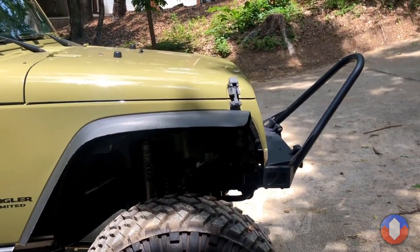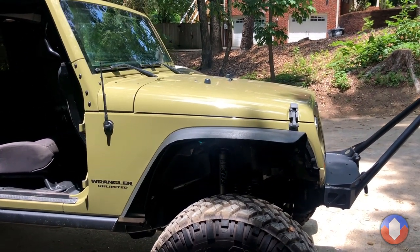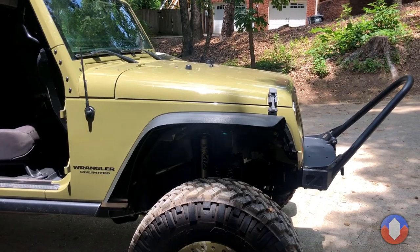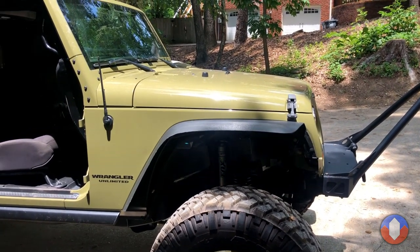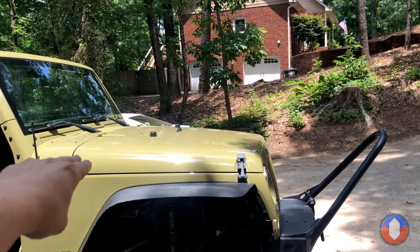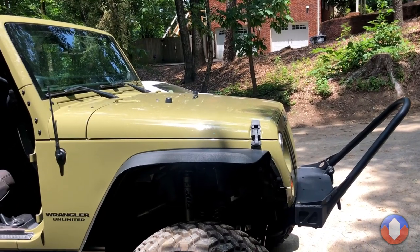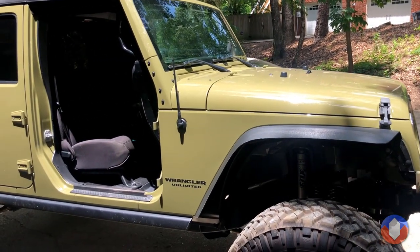But I think worst case scenario, we're probably gonna have to invest in some roller rockers or whatever they're called. Camshaft followers, whatever you call them, because those bearings go bad. Hopefully it's going to be the one furthest back, so it'd be a lot easier to slip the camshaft out, put a new one in, and then be noise free.